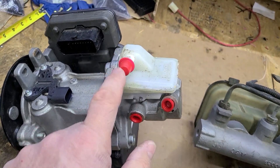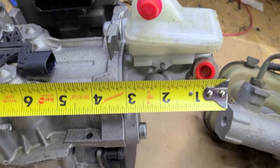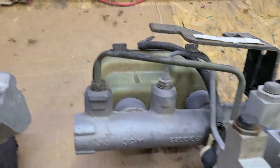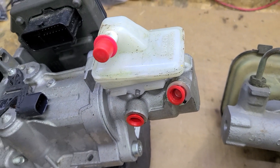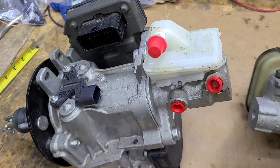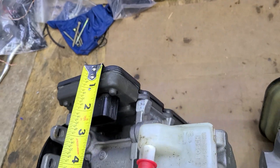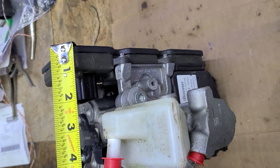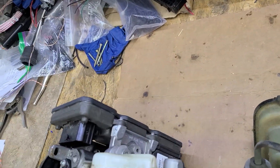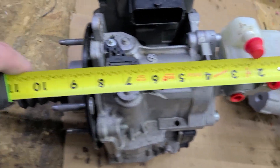That's all that's really needed. This brake master cylinder looks really, really tiny, and it truly is — it's only about three inches by whatever. I think the piston diameter on the CR-Vs is like 26 millimeters, which is a little bit over an inch. Similar to the Astrovan, guys have done testing on these, and pretty much for pushing down the brake pedal all the way, this gives you about 11 to 15 cc's of hydraulic fluid for four-wheel disc brakes, which is nice for the application I'm going to be doing. The dimensions: from the back of the control module over to one side is about six inches, the bottom of the motor to the top is about nine inches, and the overall length from the master cylinder is like eight and a half to nine inches.